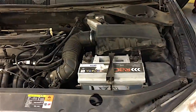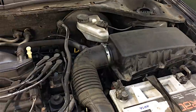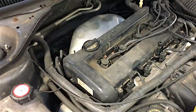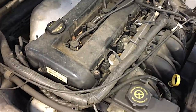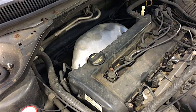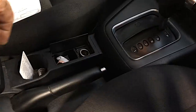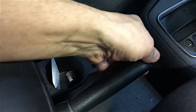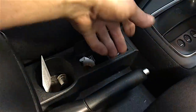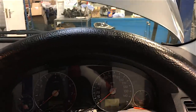I'll just lift this bonnet. Check your brake fluid level. They're good engines - the two-litre Duratec - they're good until they start burning oil, and they will all eventually start burning oil, it's just a trait of the engine. Good timing chain though, I've done a video on replacing that chain. They're not bad cars actually. I'm going to check this handbrake lever - normally these levers pull up and feel loose with nothing happening for a lot of travel, then you know there's a problem. This one - that's a really good handbrake.